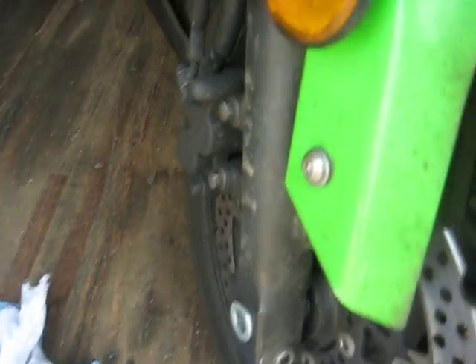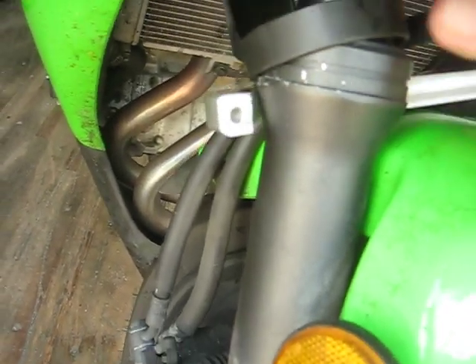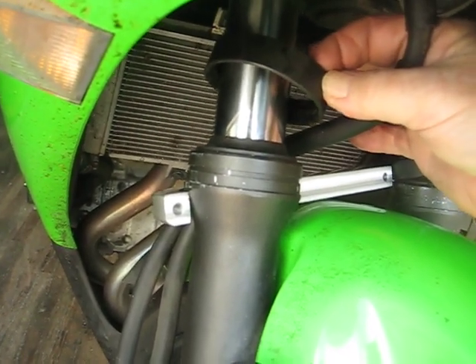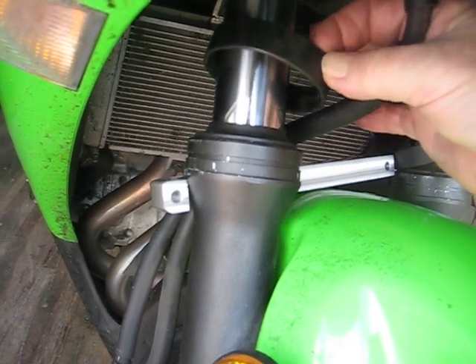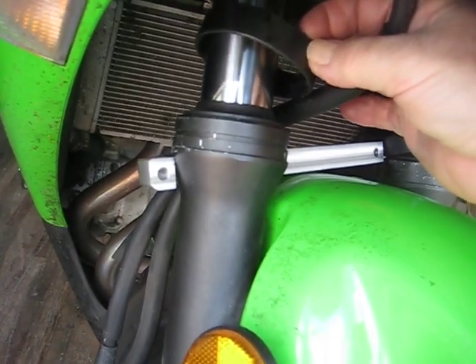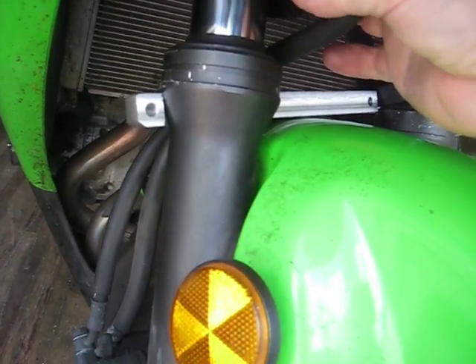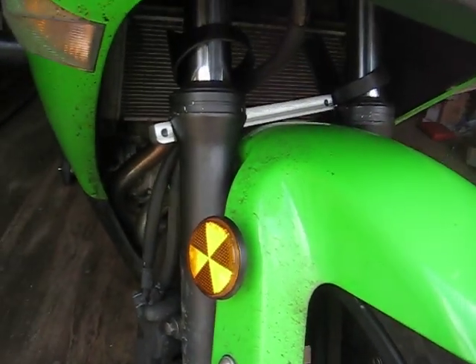The other piece — let's deal with this. These are the old dust covers, right there. That's the only pain in the ass. This thing will bolt up easily, four bolts, but these things — if you want to save them, you've got to pull the front forks out. If you don't, you just cut it because it's plastic and that's it. Then just bolt the stupid thing in there and everything fits and it works.